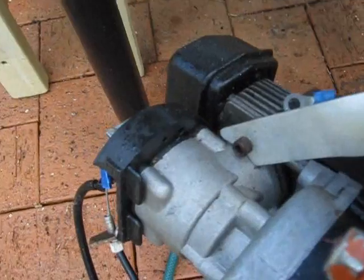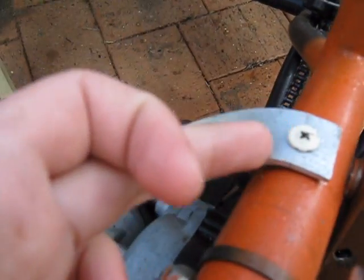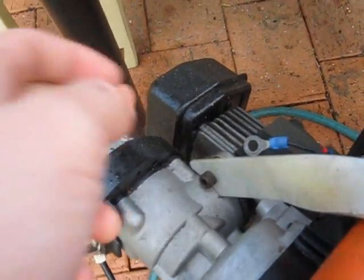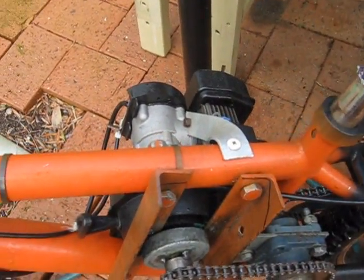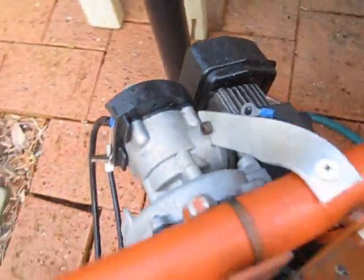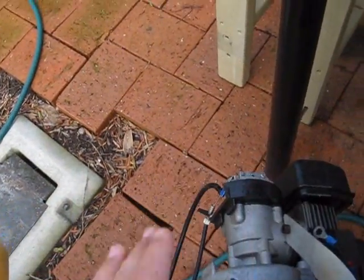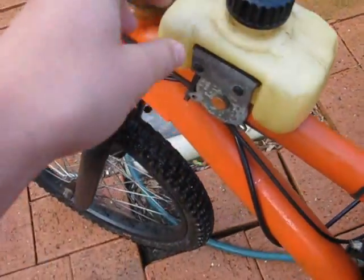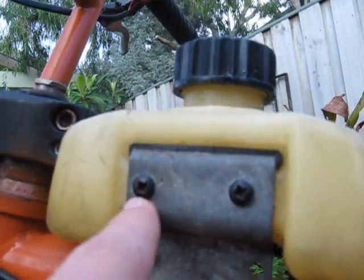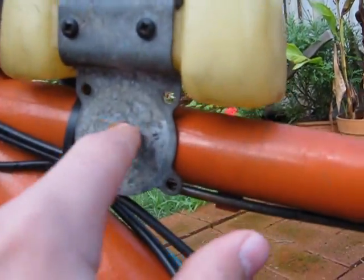Later on I made a bracket that twists from here down to the head bolt. I did an overhaul on this motor — I replaced all the gaskets, fitted the bigger carburetor, and ported the heads. It's got a stock muffler, but apart from that it's pretty much a stock engine. For the fuel tank, it was off steel — I screwed a plate onto it and bolted it to the frame. It's got a fuel tap and the fuel line runs down to the carburetor.